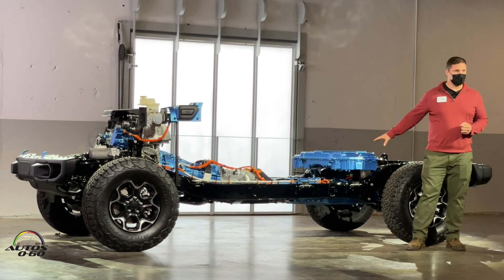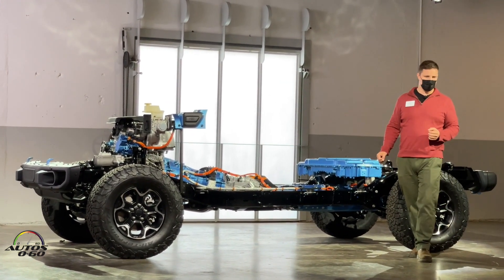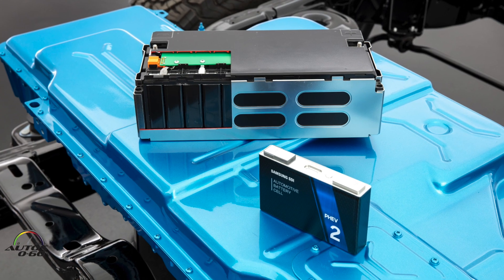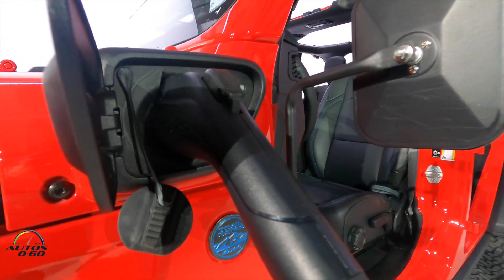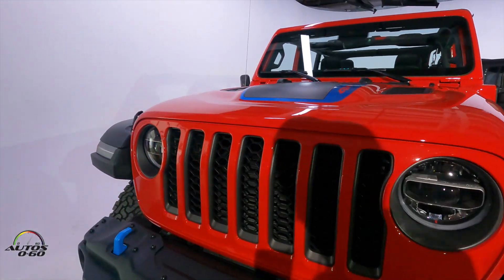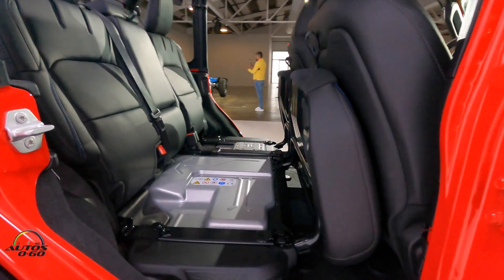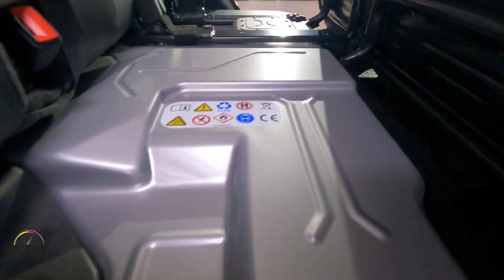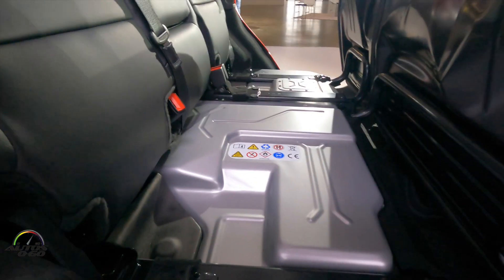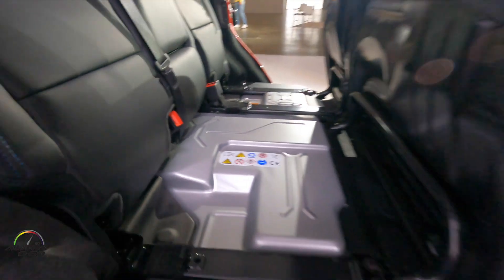Underneath the rear seat, inside the cabin of the vehicle, is the big battery — a 17 kilowatt-hour lithium-ion battery. We chose the lithium-ion chemistry because it has no memory effect, so you can charge or not, it doesn't really matter. It also has a pretty wide operating envelope, meaning it can operate cold, warm, charge, or discharge without much concern. That said, the battery does like similar temperatures to the rest of us — about 70 to 100 degrees Fahrenheit. Therefore, we've got a dedicated cooling and heating circuit to keep that battery at its operating temperature for the best range.